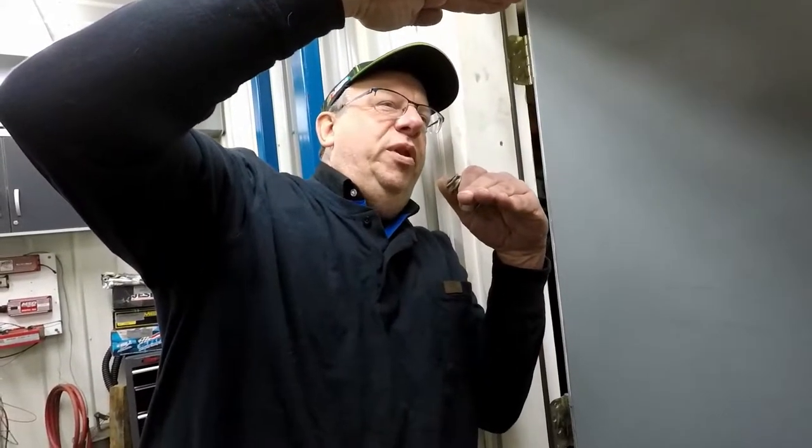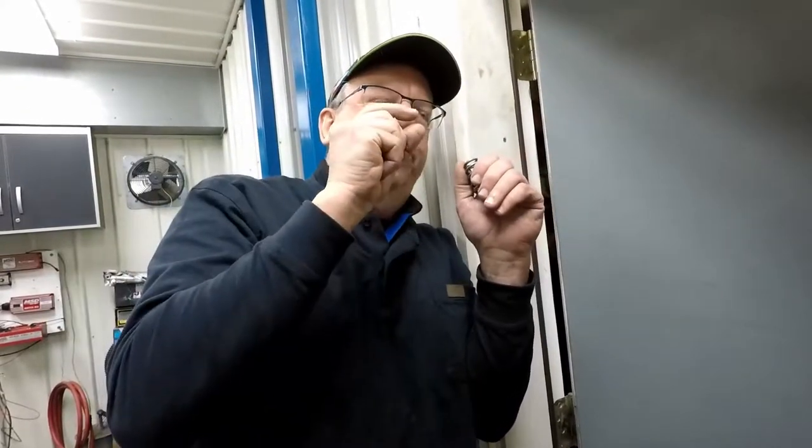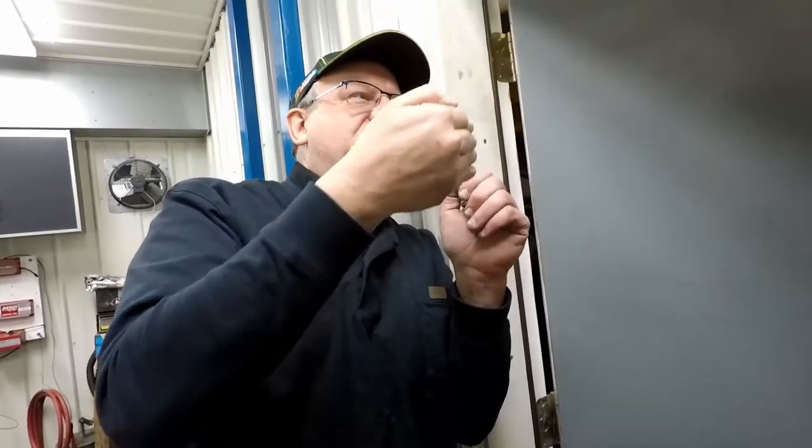So now I'll add my, let's say, 500 thousandths of lift to that inch 50 spec. Now I've got an inch 550. That's where I need to put them in at. At an inch 550, when it goes open a half an inch, now it's an inch 50. It's 50 thousandths away from all the coils touching tight. Does that make sense?